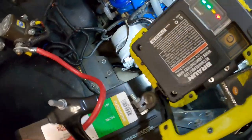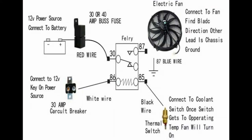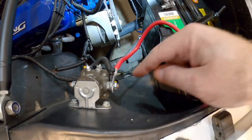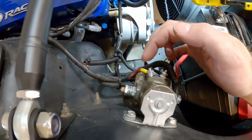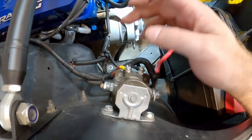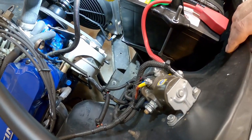The wiring part isn't very exciting. The wiring diagram that came with the eBay fan has spelling errors and doesn't make complete sense. But I found a better wiring diagram online that describes what we want to do - the wire colors are just different. We can combine the two diagrams to get what we need. The biggest thing is we're taking power off the positive side of the battery, grabbing a switched terminal off the fuse block so that when you turn the key it turns the coil on and makes that post active, and we'll run that to the relay. The back side of the relay goes to ground since we want this fan on whenever the car is on.